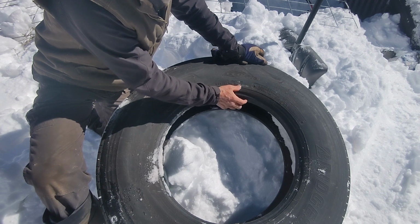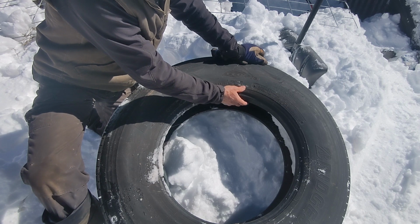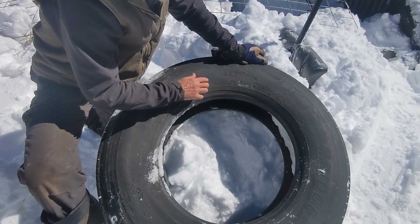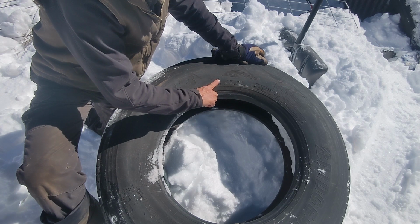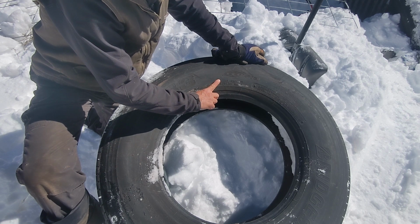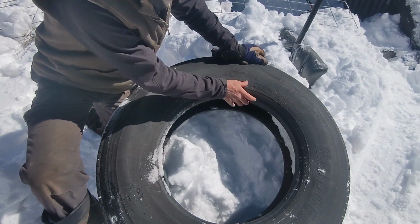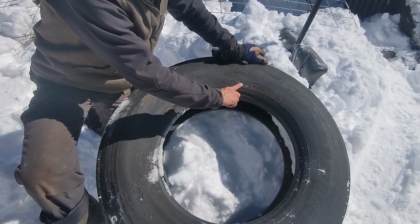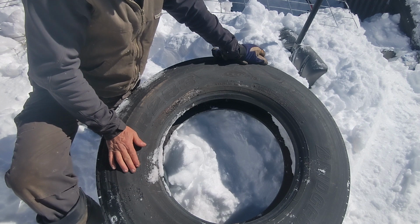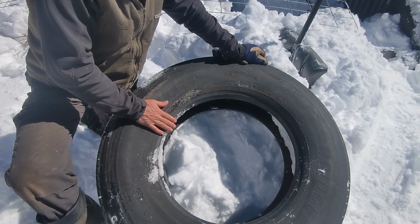The tire was originally made 3813, so the 38th week of 2013, and it's 2023 right now, so this tire is 10 years old. When it was retreaded the first time, it was retreaded the 45th week of 2014, and then again, most recently, before I got it, the 12th week of 2021, so 2 years ago. So this is essentially a fresh recap on a casing that was inspected and found to be good just 2 years ago.